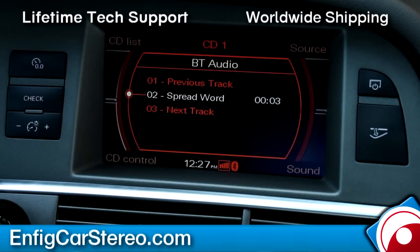Today we're in a 2006 Audi A6. We just installed the Dension GW-52-M01 — it's a single fiber optic port. Dension's website says you need the dual for an Audi, but you don't; you need the single. The dual will work, but it's just more money, so there's no reason to get it. We just installed it and I'm going to show you how it works.